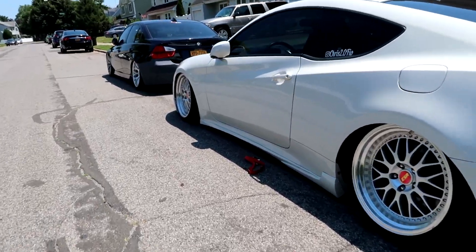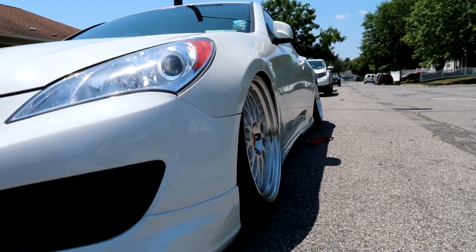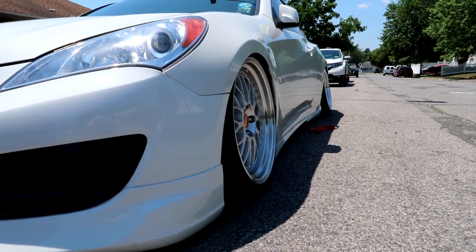In the front I have about negative three degrees of camber — not as much as expected. The reason is that in the rear I have both camber arms and toe arms, but in the front I only have the lower control arms. If I want more front camber I'll need to buy tension rods, because my stock tension rods are pretty much maxed out and almost off the threads, which is a little sketchy.